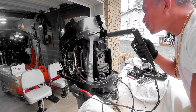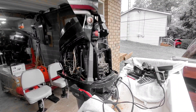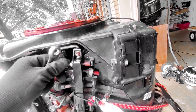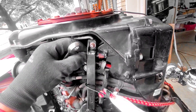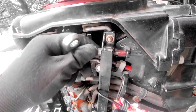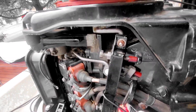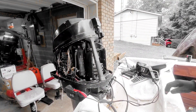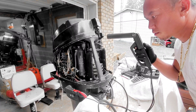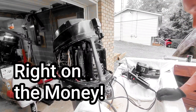It's probably closer to 30, so I need to go back just a little bit. I'm going to loosen this 11mm metric screw here and screw this end in just to push the timing forward, then lock it. Right there — that should put us at 28. Okay, 28 here we come. And we're right on the money. The timing is set on the engine.